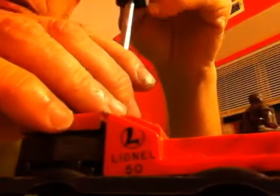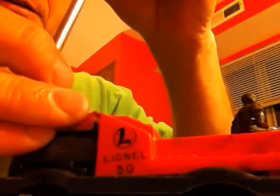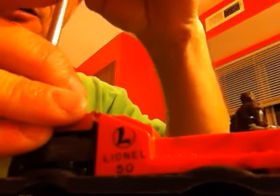Now there are two screws on top of this, which you remove. It's just a Phillips screwdriver. Well, all you will need for this whole thing here, it's the only tool you will need. And there's also this guy in the back. He just pops right off. And you set him in your parts thing where you've got your screws already. And you take this screw out.